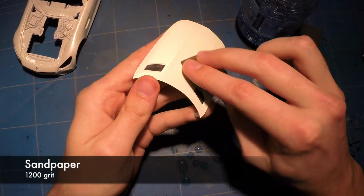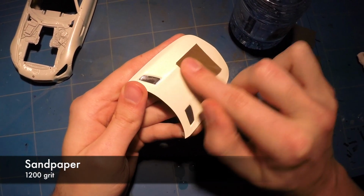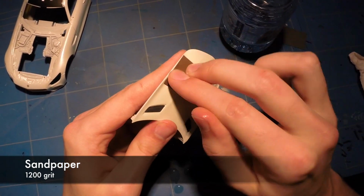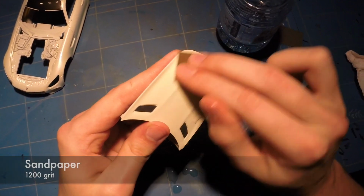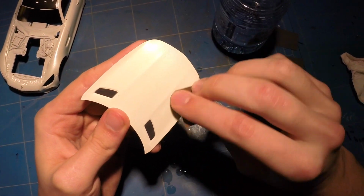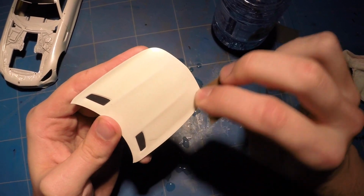Last week I was telling you guys that the paint turned a bit yellow due to the plastic seeping through to the primer, through the color, and finally through the clear as well, making the white look more cream and have a lot of uneven spots all over the place. Some are more yellow than others, and some are perfectly pearl white. Now that was not really the way I wanted to do this, so I decided to do it over again.